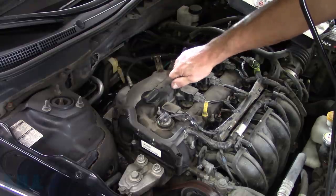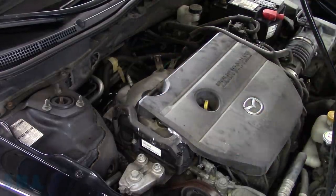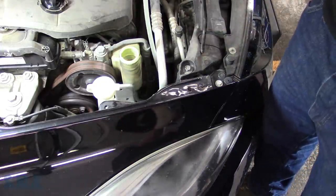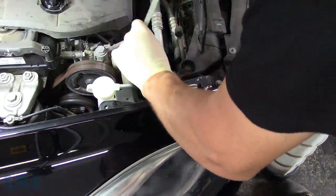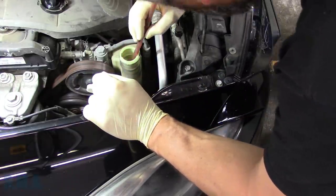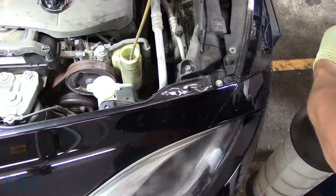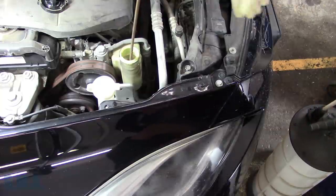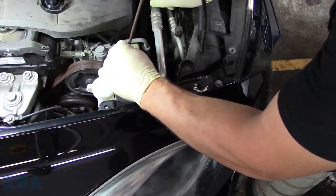Two and four, we'll stick them on there. Got some fuzzies. So up next we have to change the power steering fluid. Now there is no drain on these — I always say the solution is dilution. So we're going to suck the fluid out of it. This probably has a screen in the pump, we're going to suck some out here, see if we can orchestrate our way past the screen. Maybe we can, maybe we can't. I think we're in there now. Here's the old fluid extractor, we'll pull all the fluid out of it. And then what we do is we fill it up, we run the wheels back and forth, and then do this for several quarts of fluid. That's about the best you can do.